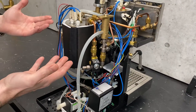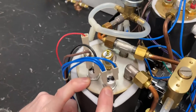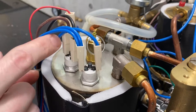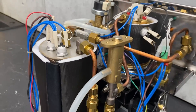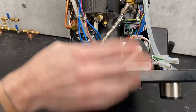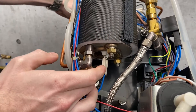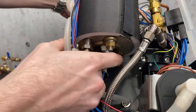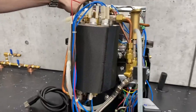Sticking to the steam boiler since we're right here — you've got two high limits right on the top here, one for your load and one for your neutral. They are resettable, so two resettable limits right there. Down below, you've got two legs going to your heating element. On the steam boiler, the heating element is on the bottom here, bolts in from the flange. There's just a seal underneath that, so it's fairly quick and easy to replace.